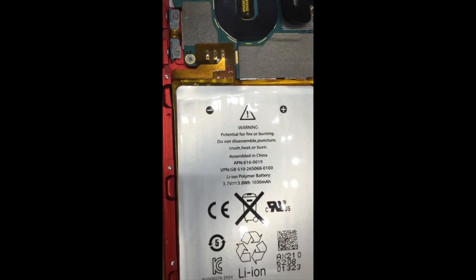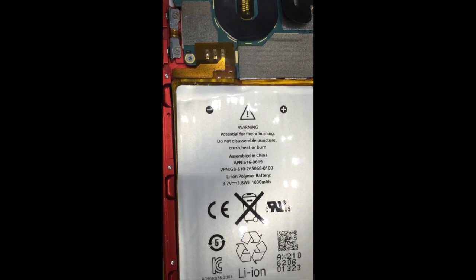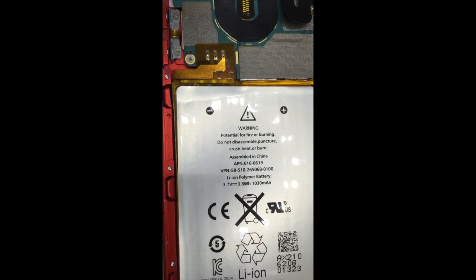But before I solder it back into place, I like to apply a little bit of alcohol on top of this. The reason is because I had my fingers all over it, and I want any oils that could have come from my fingers onto the connection point off. You want to make sure you have a good solder joint. This is the critical part. If you have a bad solder joint, it could cause it to overheat depending upon the nature of the problem, or an intermittent circuit. All of it is obviously not desirable.